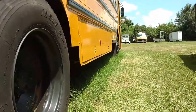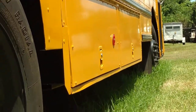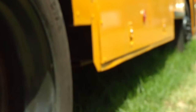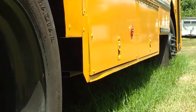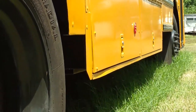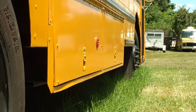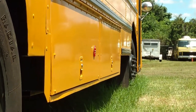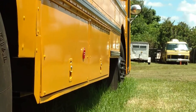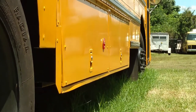I like the design of the original belly boxes that were part of the bus. But if you look at the bottom there, it's just flapping — it's all bent in and it's got a retainer on the inside. I do like the latches, but those cam locks were shot out when we got the bus — painted over, and I had to replace them anyway. The doors are a little wobbly. I feel like this coming up flush like that is good, as long as I have good stability and good mechanisms to keep it in place.